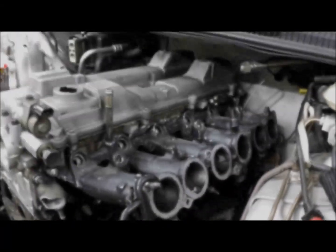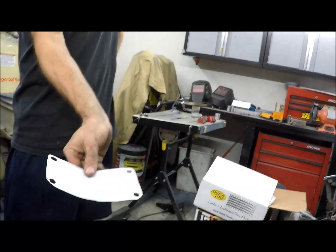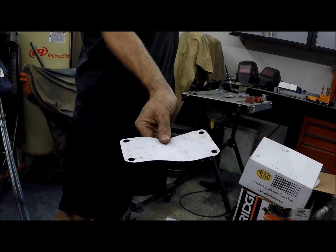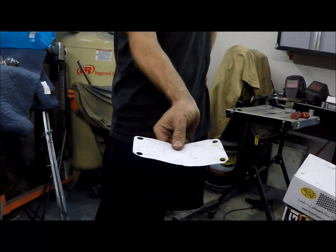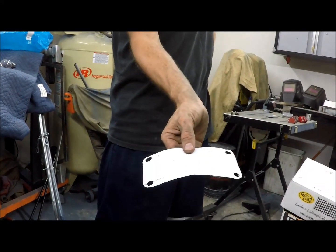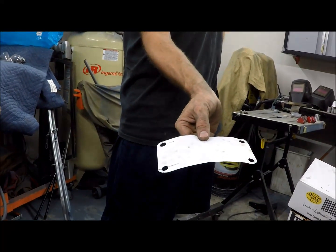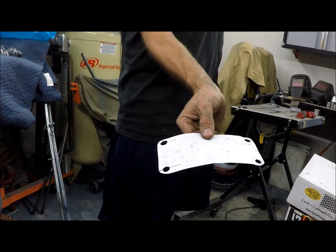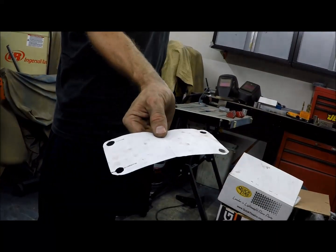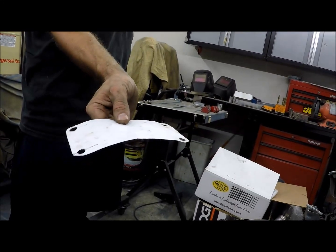Motor mount plates right now, is that right, Blake? Yeah, we've got a little bit of a CAD design here, or cardboard aided design. In this case, it's some copy paper design. But these are basically plates that are going to pick up the 2JZ factory motor mount points, and this is going to get cut out of 1/4 inch steel plate, and then we'll have some tubing that runs down to the motor mounts I added to the subframe. And that'll all get braced and built so that it doesn't fall off at 1,000+ wheel horsepower.